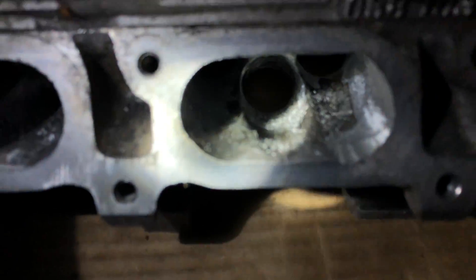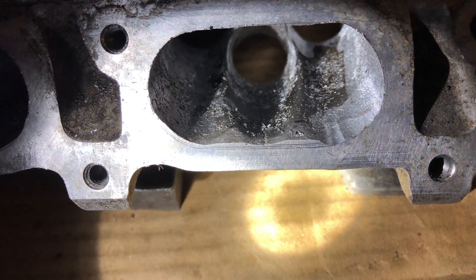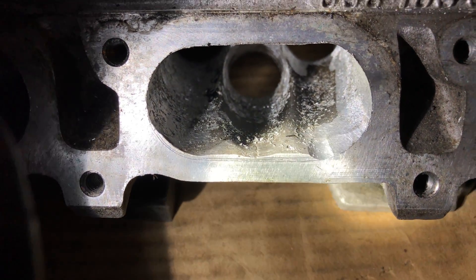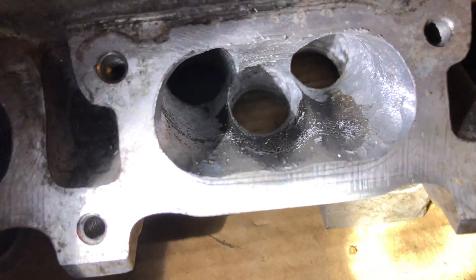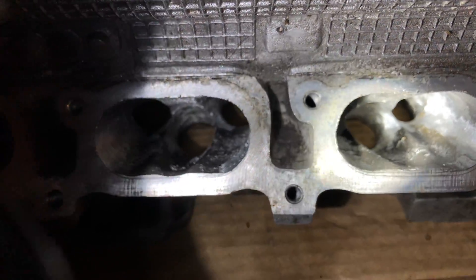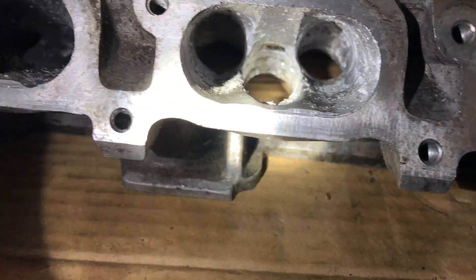Match porting - I still got to do the bottom part. There you go - you see there's the line where I need to cut. The top is already done, the bottom I still need to do. This doesn't have to be polished but it needs to be smoothed out. I'm just trying to get it to the size I need and then smooth it out.